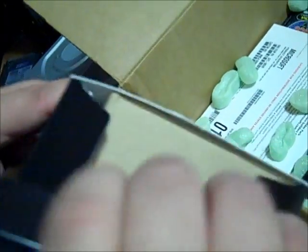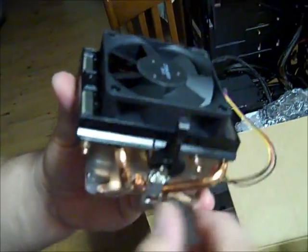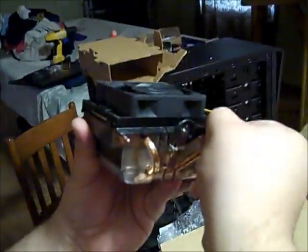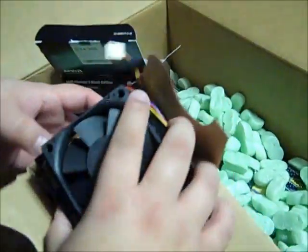I already cracked it open last night because I was very excited. This is the stock heat sink I'll be using for the time being. I'll see how temperatures do on benchmarks — if it gets too hot in the summer I'll switch to aftermarket cooling. I will be removing the pre-applied thermal paste and replacing it with Arctic Silver 5. It comes with an 80 or 90 millimeter fan. AMD's stock clip brackets are easy — snap it on this side, snap it on that side, lift the handle, done. Much easier than Intel's push pins.